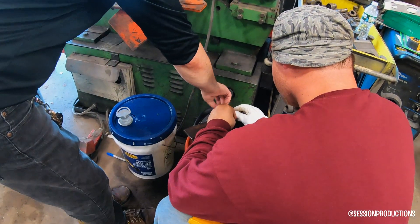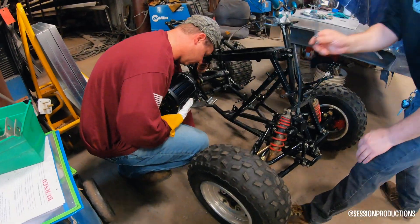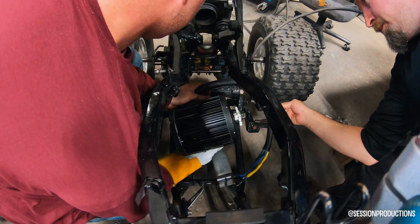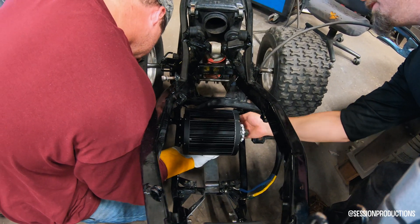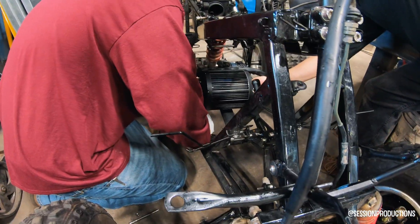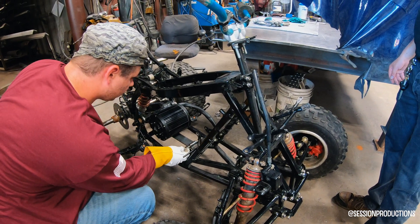As you guys can see, they're just screwing it into the original holes. But if you guys do this, make sure you get longer screws because the stock screws they give you aren't obviously long enough. You do not want to go out on the trails and give this thing a rip for your first go and have the motor screws fall out — that is not a fun time at all. Make sure you get a little bit longer screws, but make sure they aren't too long either, because those long screws can go right into the motor and if that motor is spinning really fast it can really mess up the motor. Measure the steel, measure the screw, add just a little bit, and you'll be fine.